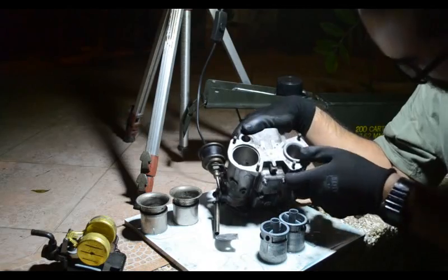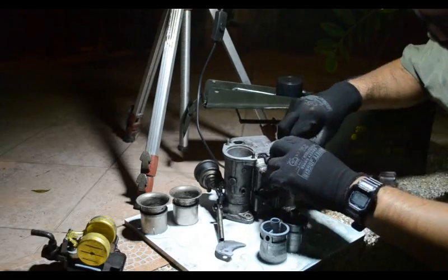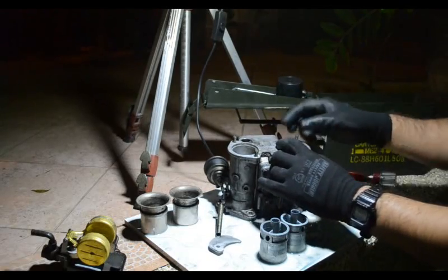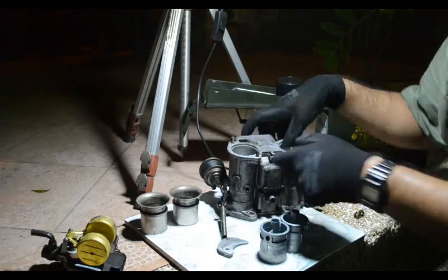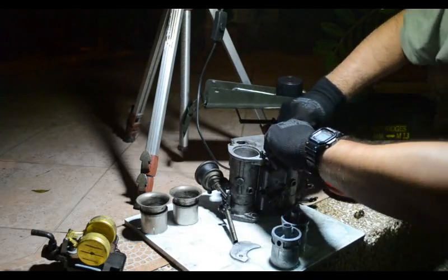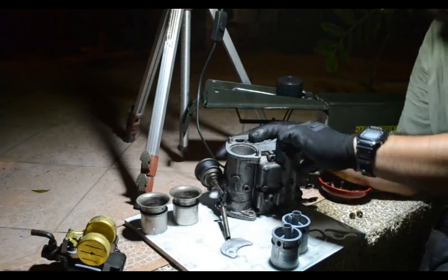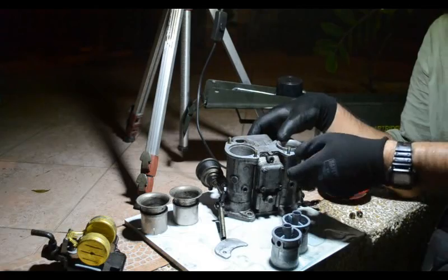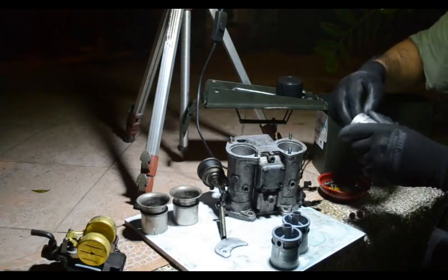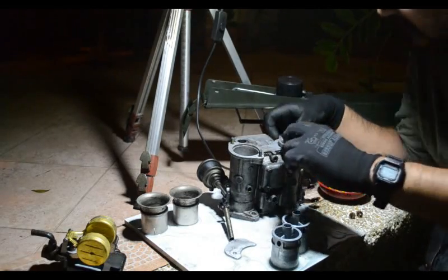This is when we get into tuning this later, if we make that video. You'll see that there are maths that basically size that primary venturi. That number actually is sized for a specific engine size and target RPM that you want the engine to run at. That has to fit. Sometimes it's dirty. That has to fit kind of tightly in there.